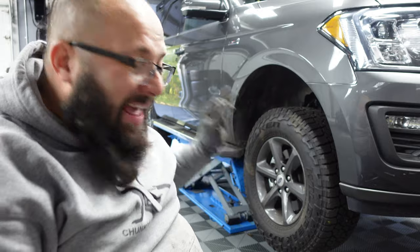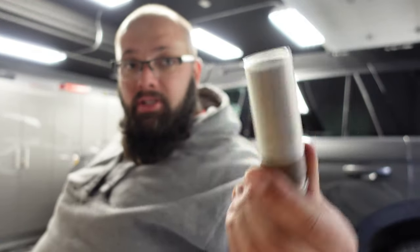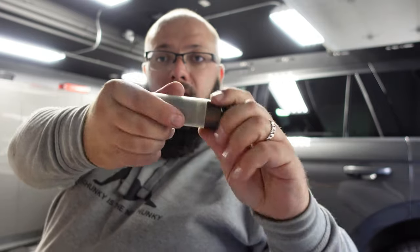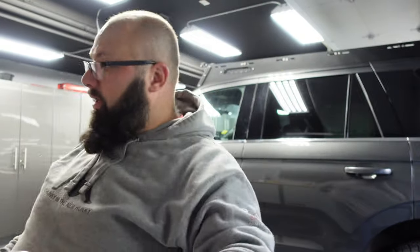Let me find out the spec first, and then I'll show you the TPMS monitor. The torque specs are 150 pounds, so I'm going to torque these up, jump in the cab, and then I'll show you how simple it is to reprogram the TPMS. If you've been following me for a while, you know I use Sonic tools. This is an example of a Sonic lug wrench — it's got a plastic guard so you don't scratch up your rims. That's what I use for this video.